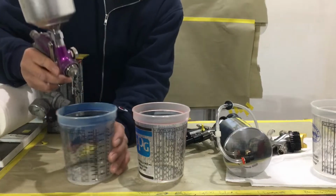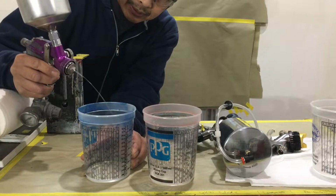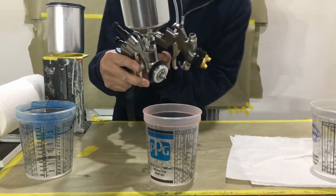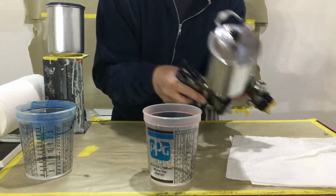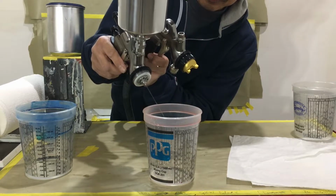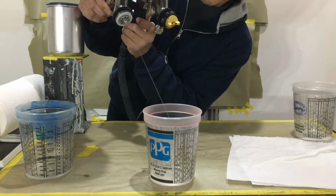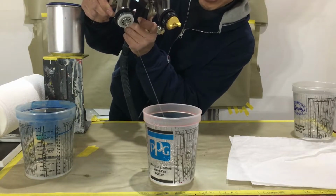Once again, this is just regular, watch. See that? See how it's flowing? Now watch the other one. Watch. Point it with the maximizer system. Get some air movement. Now watch it. See how that paint or water is being forced out with more velocity? You can use a smaller tip and get more paint on that panel.